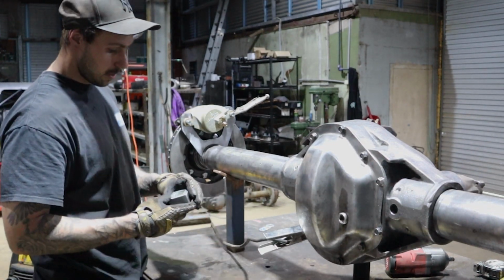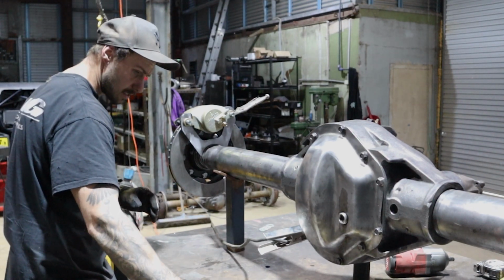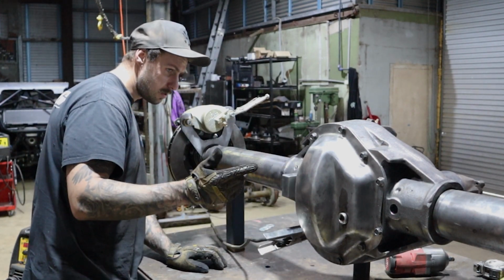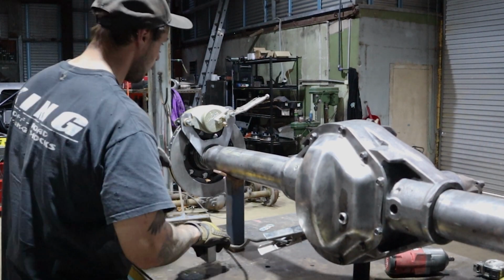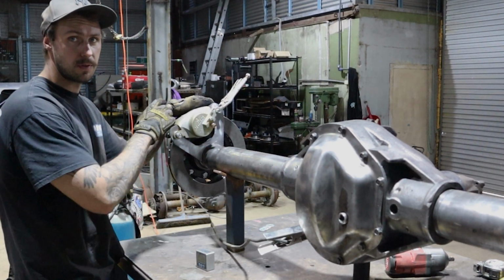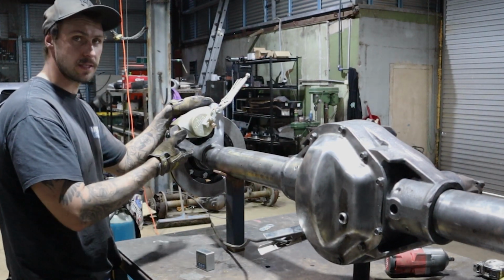So we're pretty well gonna now get an inclinometer. We'll chuck it on the desk. That's all zeroed. Now we're chucking on the housing. Housing's 90 degrees, which is awesome. And now here's the tricky part. So you have to have the bleed screw to the top. That's what you need for when you bleed these systems, the air out of it and everything like that.